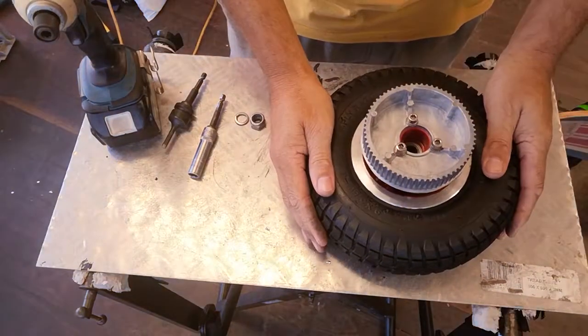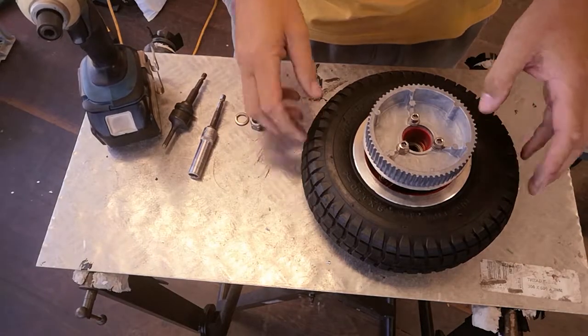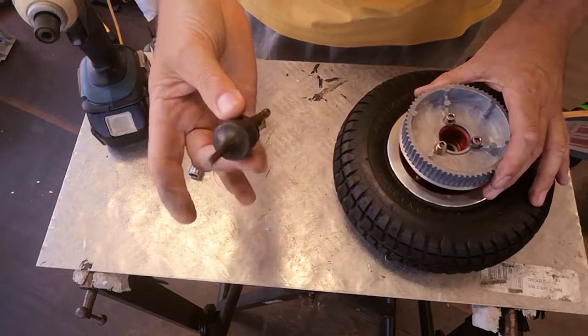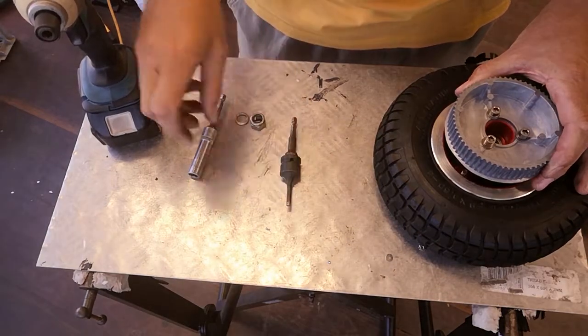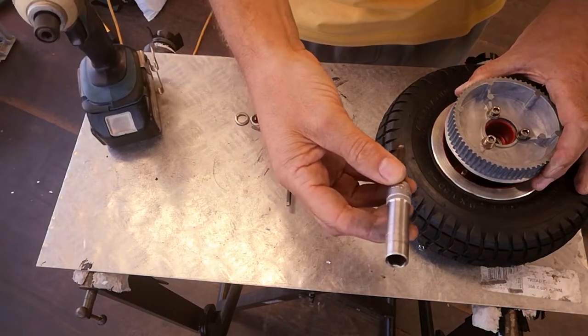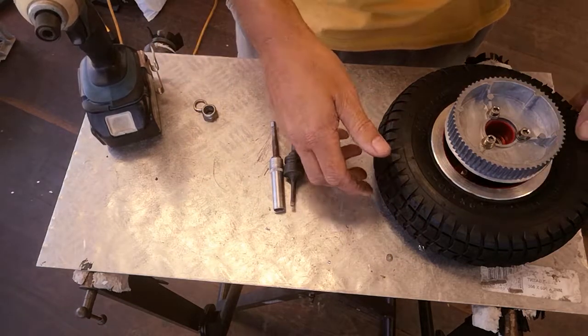This is the drive wheel. Changing the drive wheel, you do have the gear cog on the back, so there is an extra step. What you need is a 5mm Allen key or driver for your drill, and you also need a 10mm. You also need a pump to reinflate the tyre at the end.